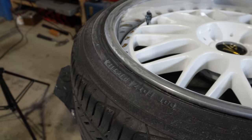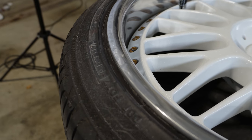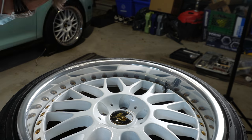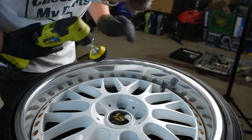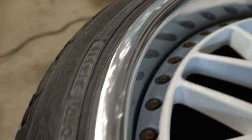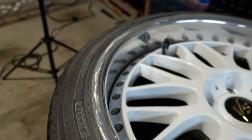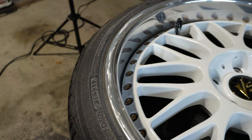As you can tell, we have been making progress. It is now much, much smoother than it was before. We're not 100% there yet, but I think after a few more rounds of sanding we should have it to a point where we can get to wet sanding and polishing. We've got it down to being smooth and we're at the point where we can start sanding with 800 grit — I think I'm at 600 right now. It's nice and smooth; I can run my finger down and feel no grooves.